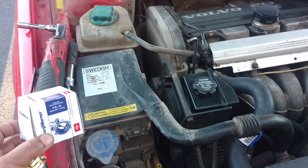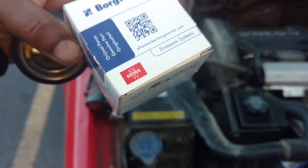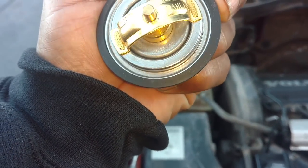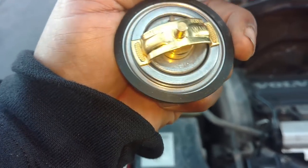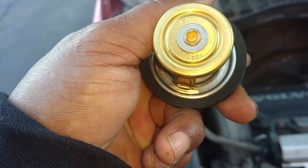We've got a new thermostat with a new rubber gasket. You should get the proper one — either from Volvo or from one of the Volvo parts suppliers. Ones that I found at the local auto parts store are a quarter inch or half inch longer; they don't sit right in the housing, they cause mild overheating, and then they lock open fail-safe — just not right. This one is a Wahler, which is a company that supplies for Volvo, in the BorgWarner box. They used to have a couple different temperatures, but now I think they're all 90 degrees Celsius.